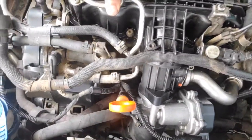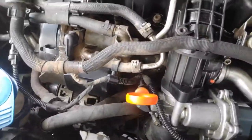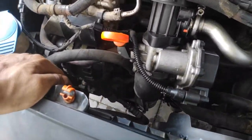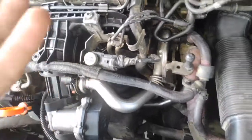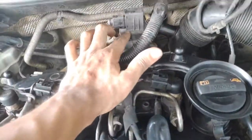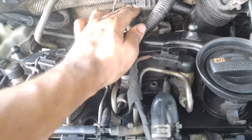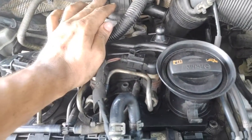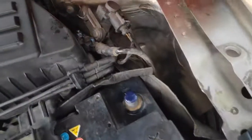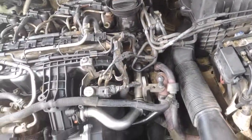I will tell you: if you have a glow plug light, if you have an error — the turbo boost pressure is low — then it will tell you which is the turbo boost pressure sensor. That means low pressure is at the pipe. No pressure on the pipe. Maybe your actuator will not work properly — the actuator is running, but the actuator will not be working properly. So the pressure will not go toward the intake manifold. The actuator is not doing that because your N75 turbo boost control valve is not doing it. So you have to diagnose all this.